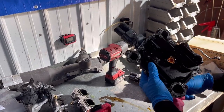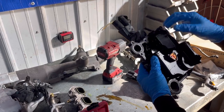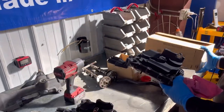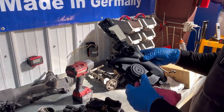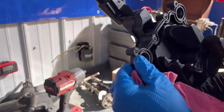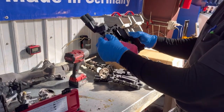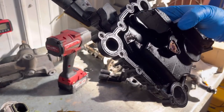This particular one was leaking right along the top edge on the driver's side toward the back of the engine block. I've seen them as bad as crumbling or breaking apart. Here's the old one next to the new genuine Volkswagen/Audi part. You can see how raised and fresh the seal is on the new one compared to how flat and worn the old seal has become. Coolant was leaking out right here at these corners — this was the worst of it.